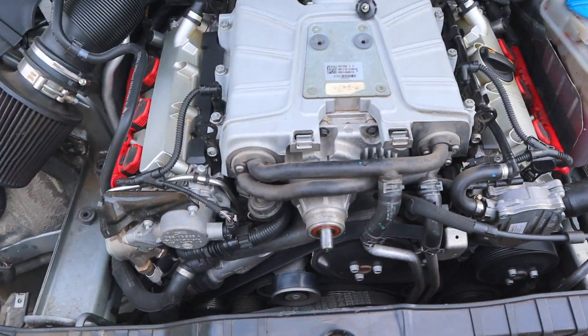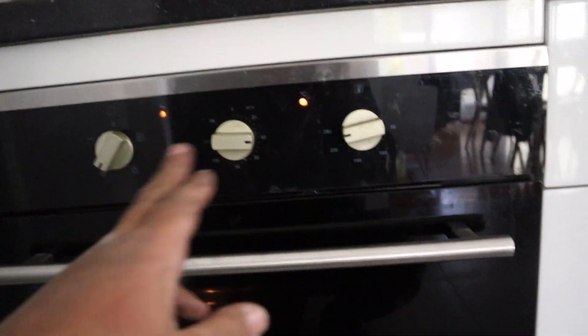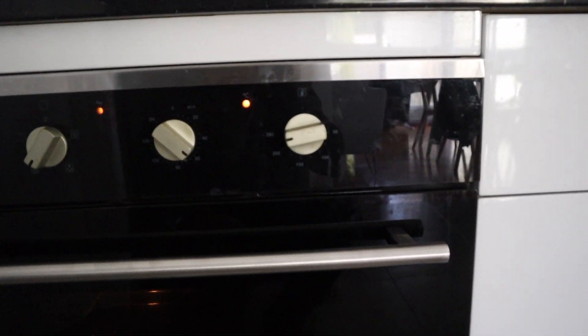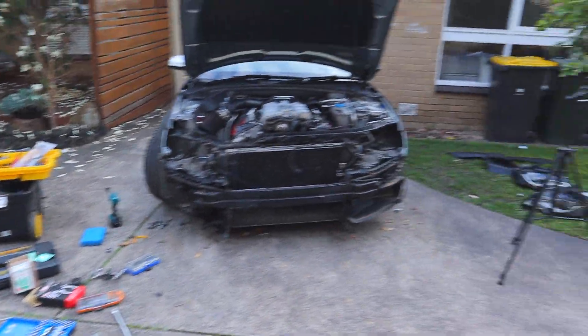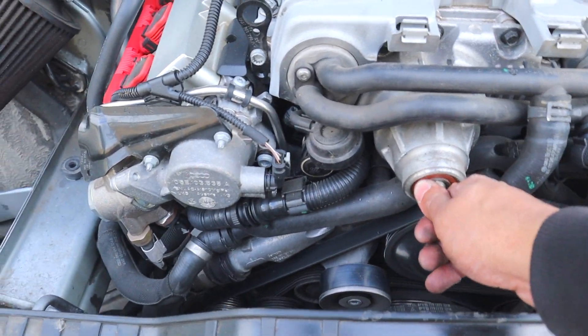All I've got to do now is get this new pulley out and heat it up really hot. I don't have a mini toaster oven but I do have a normal oven, so I've set that up to go for about an hour at just over 200 degrees. While I'm waiting for that to heat up I'll clean up all the mess, get the computer charged and ready. I'll cool the supercharger snout down with compressed air, run out with the new wheel, slap it on, put the belt on, and go back together.